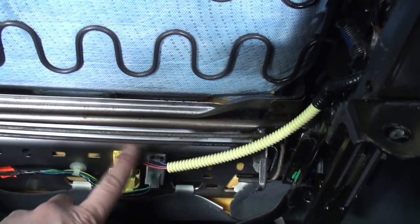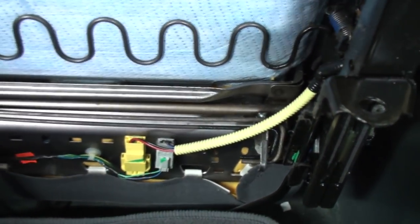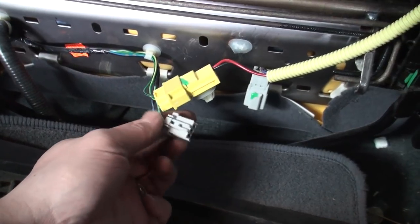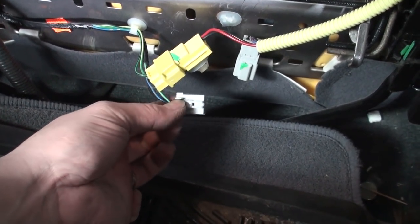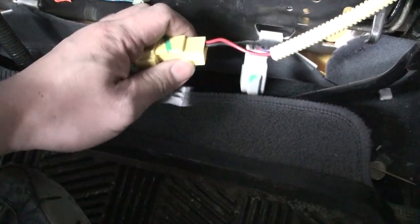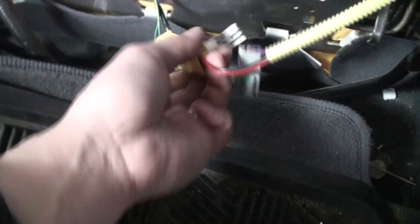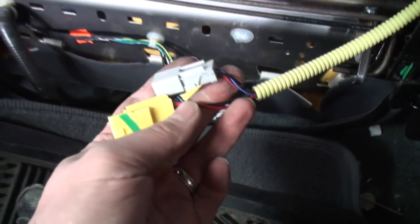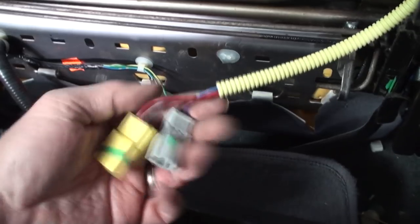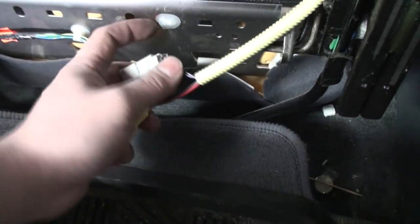The yellow cable here is the sensing cable for the airbag system — hence why it's yellow — and the gray connector is for the dashboard warning light to tell you to put your seat belt on. Most Honda connectors disconnect by pressing down a little tab, but for SRS connectors you actually have to slide the protection lock sleeve down before the harness can be disconnected. If you can't move the connectors out properly you can break the tabs off on the faulty buckle, since the new one will come with new clips.